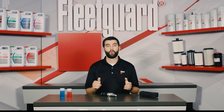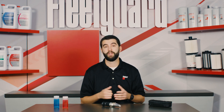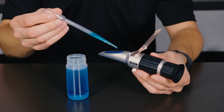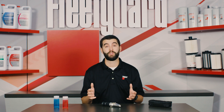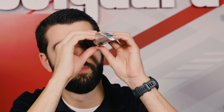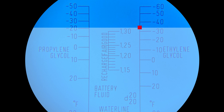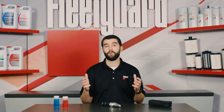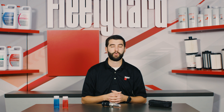Use distilled water to flush the prism and wipe clean. After calibration, you're ready to read a sample. Place two or three drops of coolant on the prism, close the daylight plate, and bring the eyepiece to your eye. A 50-50 premix EG coolant should read around minus 34 degrees Fahrenheit, and a 50-50 premix PG coolant should read around minus 26 degrees Fahrenheit. If the reading falls outside of the expectation, use distilled water or ES Complete Concentrate to correct.